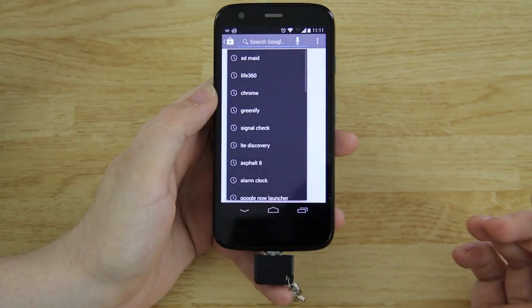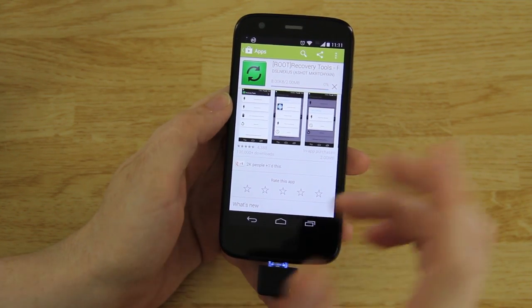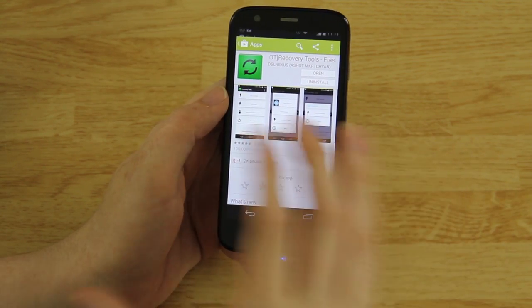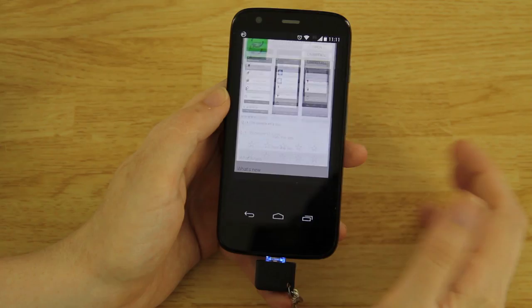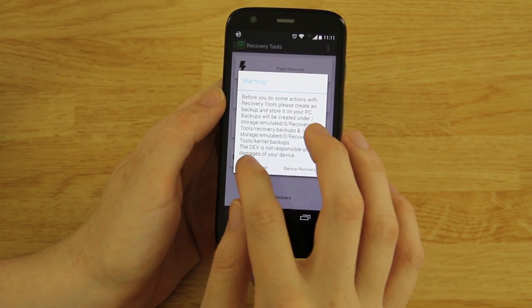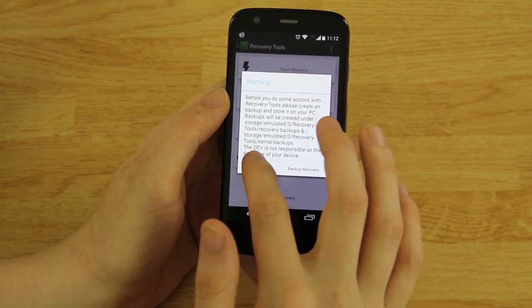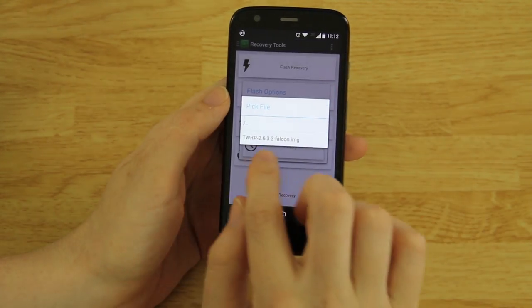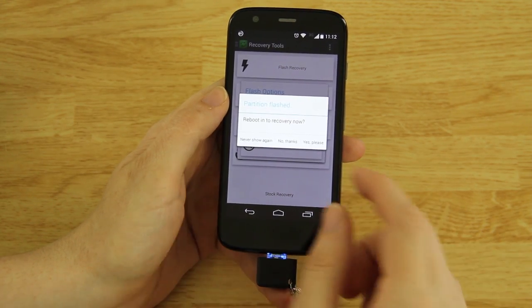You'll need to go to the Play Store and download Recovery Tools by DSL Nexus — it's free but requires root permission. If you do not have root you'll need to use fastboot and fastboot flash recovery with the recovery file name. We're going to open it up and it should ask us to grant root permission. This device has stock recovery for some reason. Hit I Know the Risk, go to Flash Recovery from Storage, go to your Downloads, and you'll see 2633 Falcon. Press on that, then Yes Please. That'll flash the latest TWRP recovery as of this video.